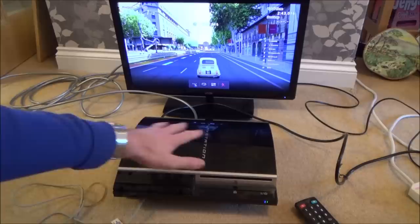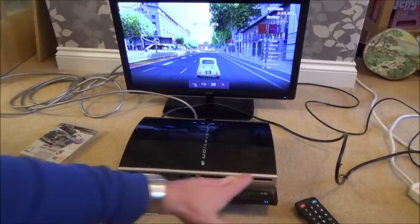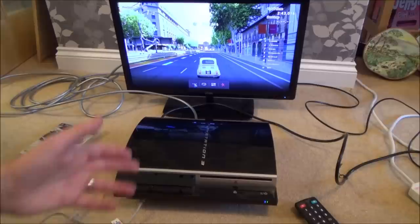I definitely want to find out what's wrong with this on and off button. It only turns on and not off. I don't believe it's anything to do with a bad contact. I think it's whatever component is controlling that is not toggling properly. Also, I need to get a new cover for this, and I need to give it a good clean, and I need to sort out the bridge rectifier. I'll either get a proper one and solder it in, so it's like more of a professional job, or just change the unit out, the whole power supply, for one of my 40 PlayStation 3s, and then I can keep this one for spares, because this is a whole heap of spares in there for future fixes.